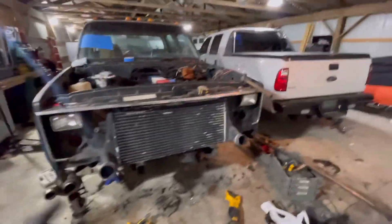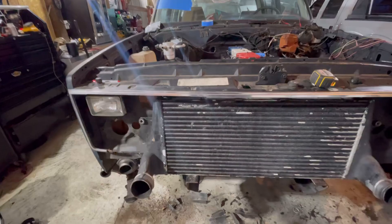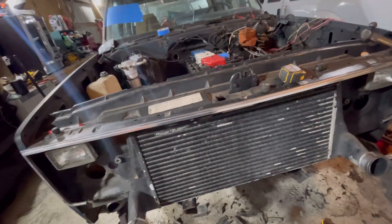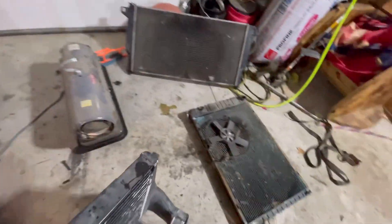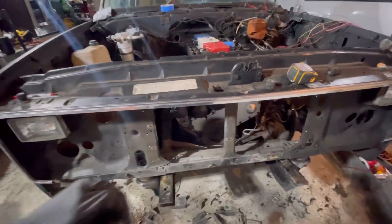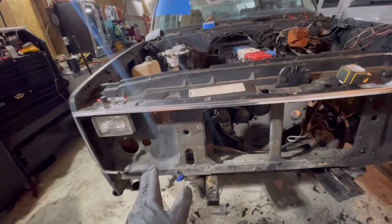As I was sitting there explaining that I kind of had a brainstorm but it won't work. Putting it out here would get into the actual physical bumper and it would just look stupid because I wouldn't be able to run that lower finish piece for the grill. On the positive side though, since everything's staying behind here the condenser can still go in — we just might have to modify some stuff, like move the condenser and cut a different hole for the lines. It looks like a condenser can for sure work, so that's sick — I was really worried about that.